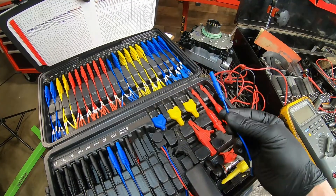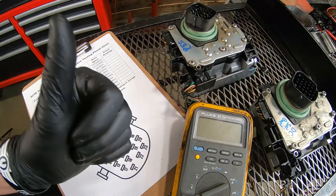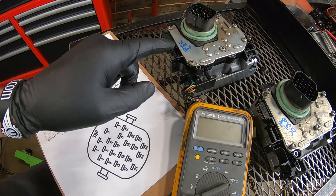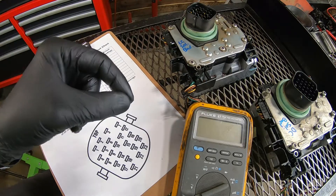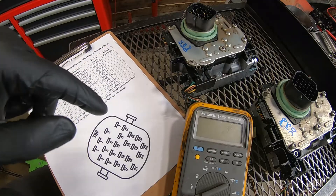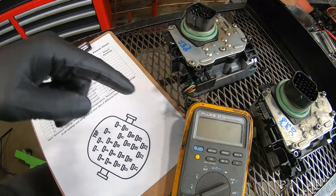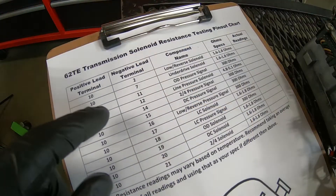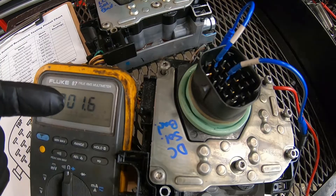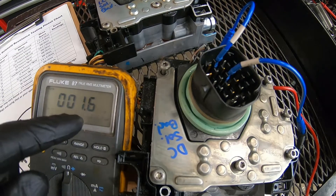So I've got two solenoid packs laid out here that we're going to be testing — both of them are bad. The one on the transmission stand is a good solenoid pack, so we won't see any problems there. The common terminal on all of these is terminal 10, which comes from the trans control relay — that's basically what powers everything up and relates to limp mode. When we de-energize that, it drives us into limp mode on these electronic transmissions. So one lead of our multimeter is always going to be on terminal 10, and the other goes to the corresponding item we're testing. With one lead on terminal 10, we'll place the other on terminal 2 to check the low reverse solenoid — we expect to see anywhere from 1.6 to 1.8 ohms. That's what we're going to use as our benchmark to check the rest.